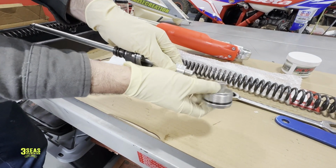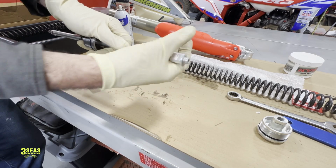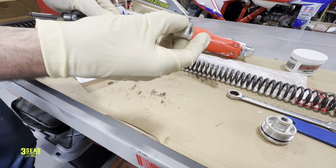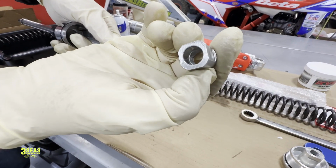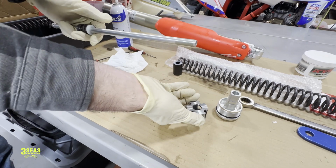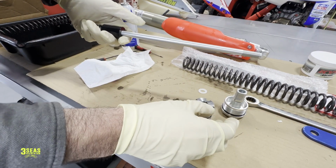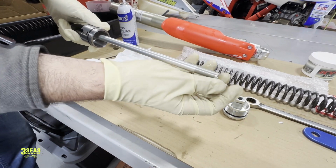So that's coming off. Set it there, and then I'm going to untwist this. Now keep in mind, there's this rod inside of here. I just kind of left the last one in. Now this nut, make sure you understand that the lip faces up toward the top cap, because I'll show you in a second. It's threaded all the way on that end, but not the other way. So this threading is threaded all the way, not threaded all the way. I'm going to set it right on top of the top cap just like that. We're going to pull our big spacer off, pull the white plastic bushing out, and throw our new spacer in there. Comes down just like that. And then we're going to put this back on this way. That's all we did, all that work just to get that spacer in there.